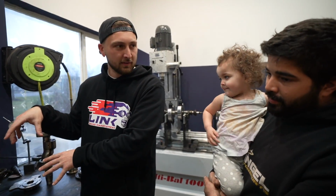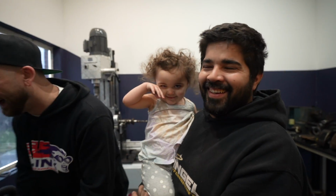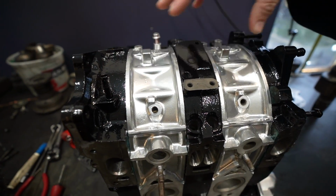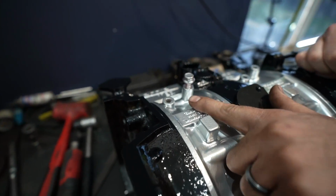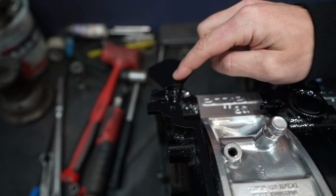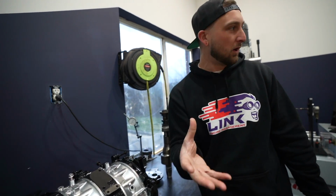So they're the stronger plates. Vargas has shown me the difference in the plates between the different generations. It seems like every generation is better. No EGR here, which is nice, and no giant hole. It's got a reinforcement on the rear dowel, this little leg. Basically, with every generation of these housings, the dowel area just gets thicker and stronger.